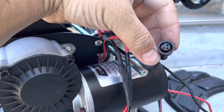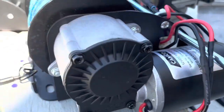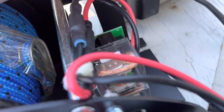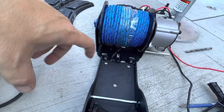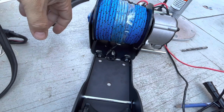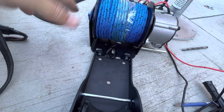Don't forget — you're gonna need to unplug it to take the cover off. This is the plug for the up/down. Once you unplug it, the cover will come right off and you're gonna be able to mark where you want to make your holes a lot easier. I put the two bolts here to have the front and the winch together. Not everybody does this — it's optional. Since I have a small area, I kind of have to work with the minimum space.